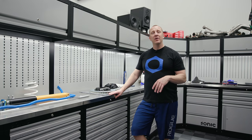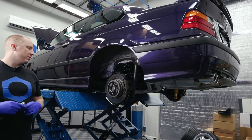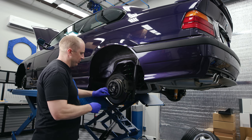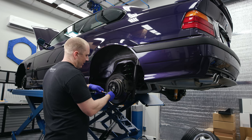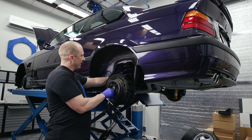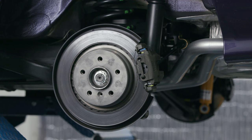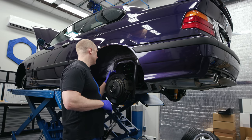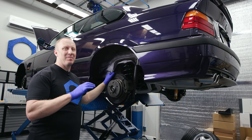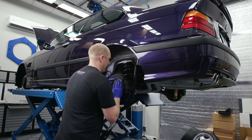Let's start by getting the spacer and brakes apart and hang the brake out of the way. Since we're doing the brakes, it makes sense to get this as much out of the way as possible while working on the suspension. I detached the top nut on the sway bar end link to give me a little more play — it was kind of bound up on the passenger side. Make sure to disengage the e-brake so this can spin.